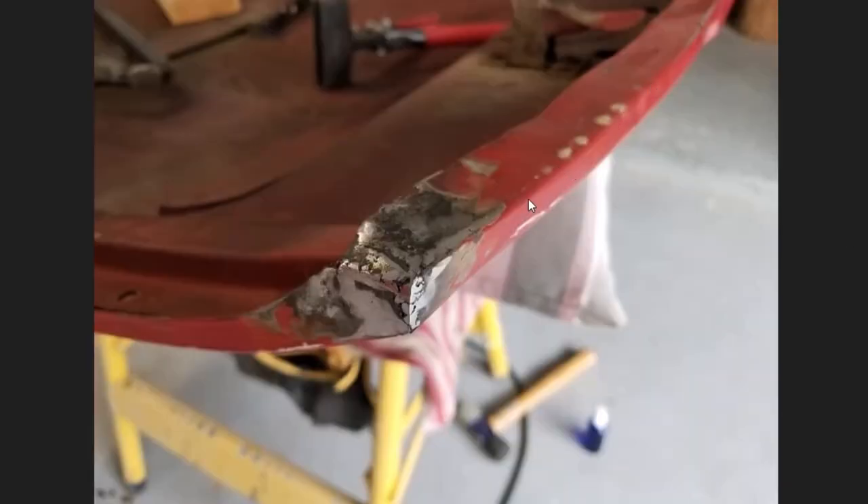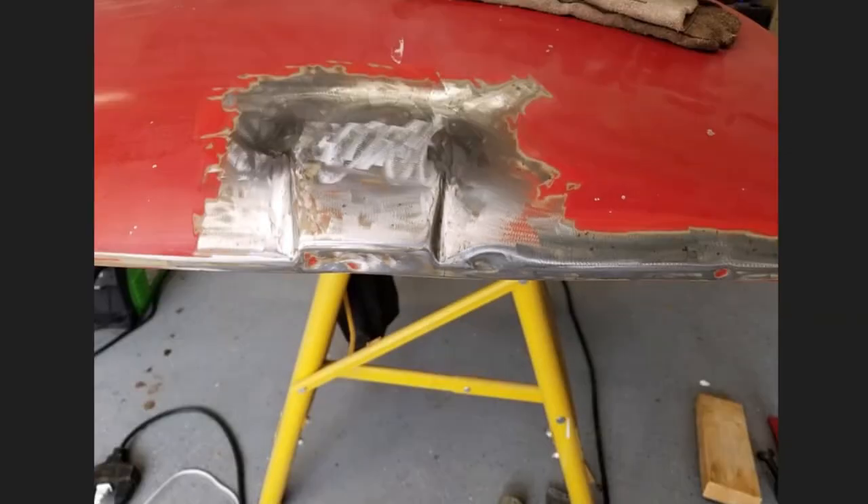Back on the hood — this corner here had so much rust on it that the weld had broken away. I supplemented that with another weld and then just ground it down into shape. Here you can see after doing the PDR, getting ready to do the bondo, we rough up the material so you have good metal contact. I did a little more hammer work on this to get the crease down — that's one of the reasons why you start sanding things, to find the high and the low spots.